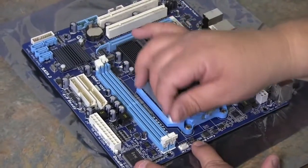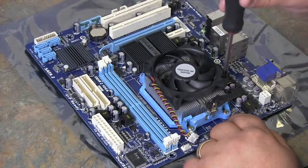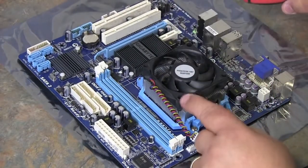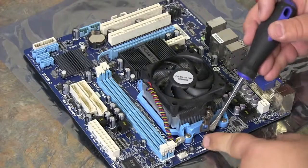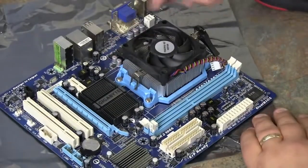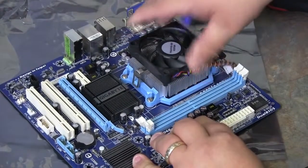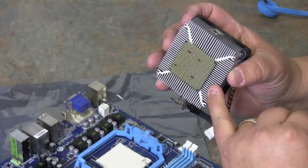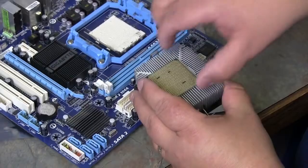Unplug your power — don't yank, just slightly pull. There's a screw inside each one of these to remove the fan, or you can take the lever and lift it up. Get a flathead screwdriver, push down and it releases on one side; once released, release the other side and your whole processor should lift right off. This processor is stuck to the heat sink because of heat sink paste — take your screwdriver and lightly turn it to break it loose. That is your processor.